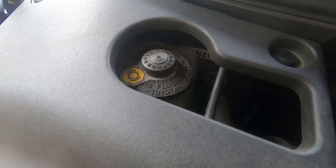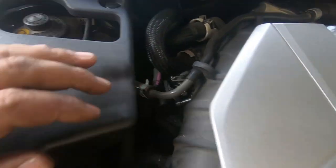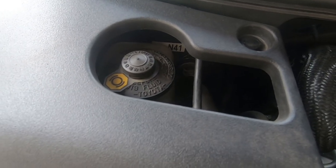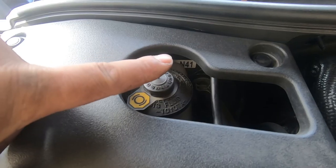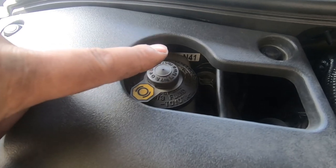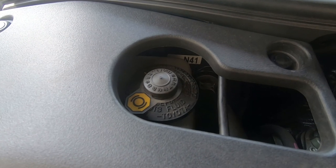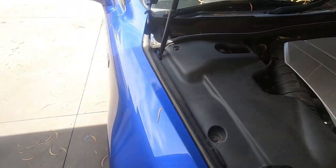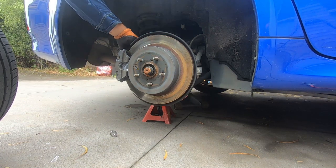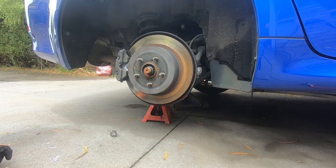In this case we haven't got any spilled brake fluid so we are good. The reason why your brake fluid may spill is due to somebody topping it up when they thought it was low. If your brake fluid looks overfilled, you can use a plastic syringe to withdraw some and squirt it out. Make sure it is at the right level after you've pumped your brakes. Make sure you've greased everything — 19mm bolts back on, guide pins in, all metal contacts greased — and you can now put back your wheel.